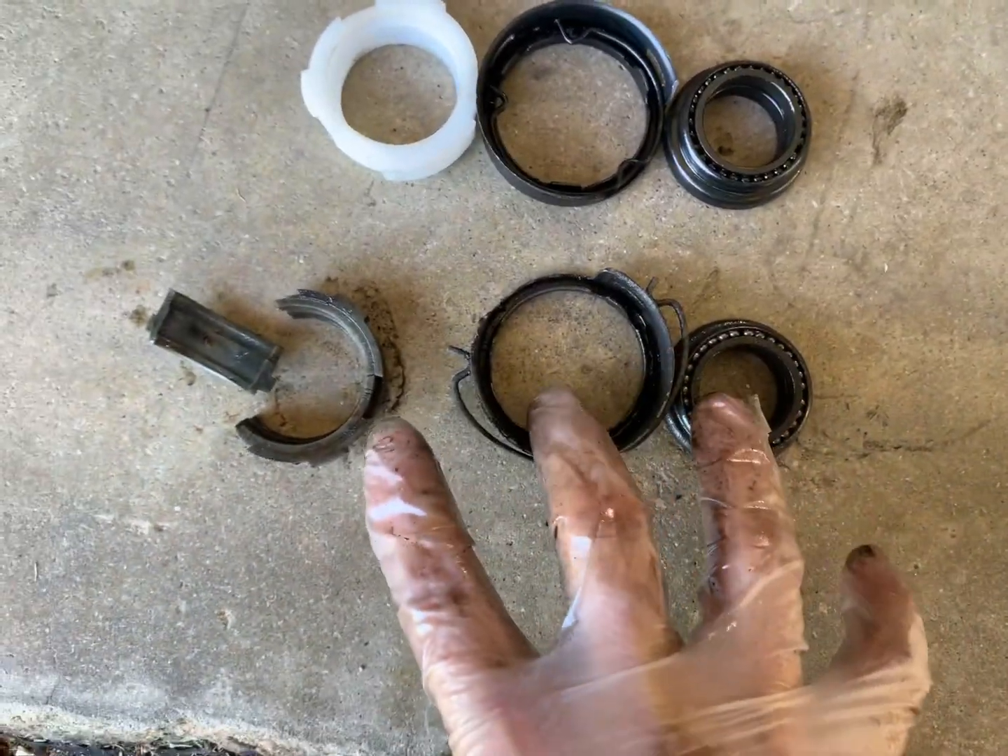The bearing was actually past the lower part of the column, so it was just kind of flopping around in there — not exactly safe. The biggest pain is getting the steering shaft out. The slip spline on the factory shafts never wants to move after a couple years. The easiest thing is to disconnect at the column, unbolt at the rag joint, use a pry bar to get the shaft out. I've been soaking it — there's a little weep hole and I've been filling that with oil and pushing it up and down. The tube is more or less full of penetrating oil.